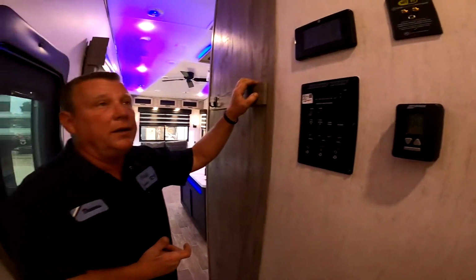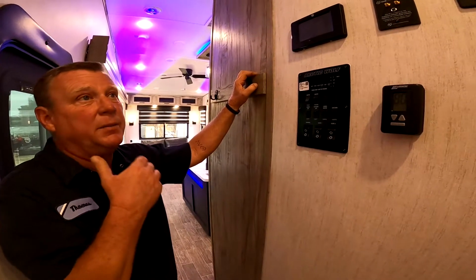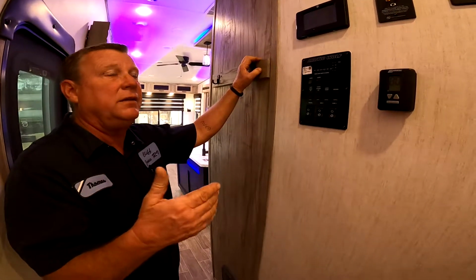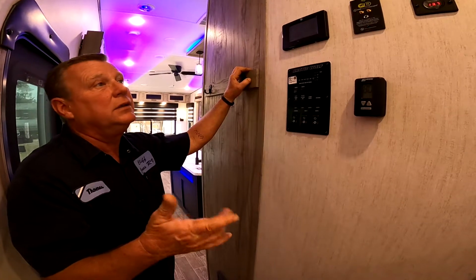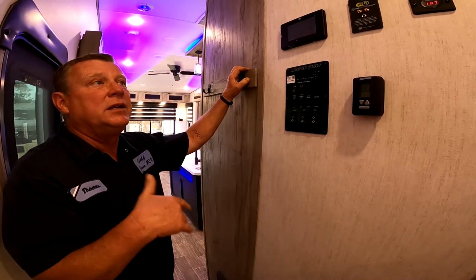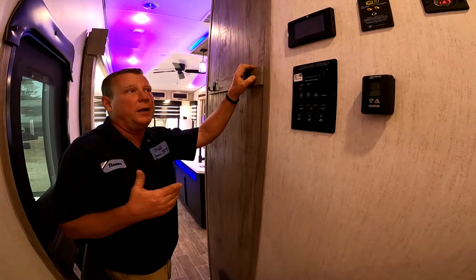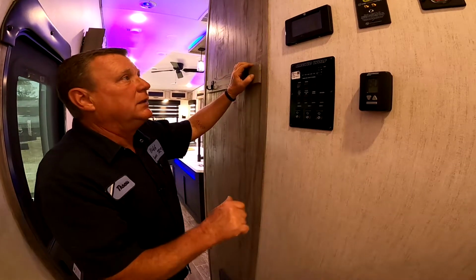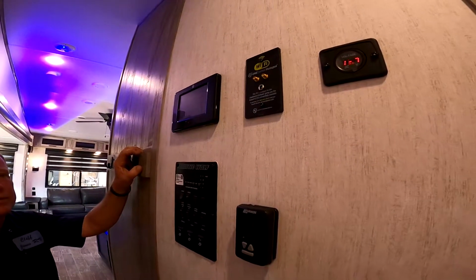Now, if I unplugged it from 120 volts, it'd be running on the solar panel, and depending on the amount of sun you have, so if it's real clear and sunny, you probably get about 13.1, 13.2 going to your battery to trickle charge it. If it's cloudy, overcast, you're probably looking a lot more like 12.2 to 12.3, somewhere around that range. So partly cloudy, you're going to probably get about 12.7. Right here is a Wi-Fi hotspot similar to what you have on your phone. You subscribe to it.